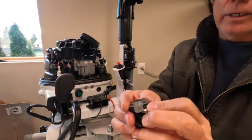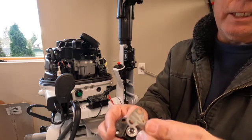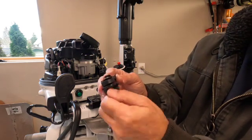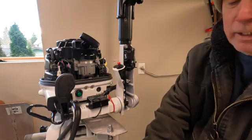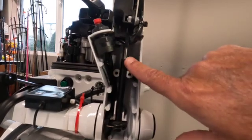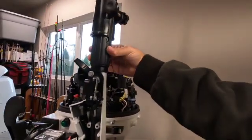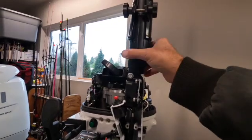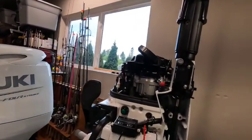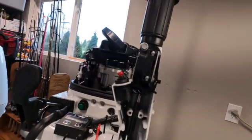This is what we have in there: a screw-down knob and a little metal plate. As the knob is screwed in, the plate pushes up; as it's backed off, it goes back down. That metal plate is supposed to apply tension onto the steel bar and keep the throttle from rolling back down to idle. Unfortunately, that smooth metal plate against that smooth metal bar doesn't apply enough friction to hold it in place.